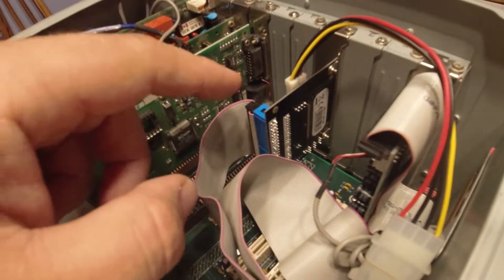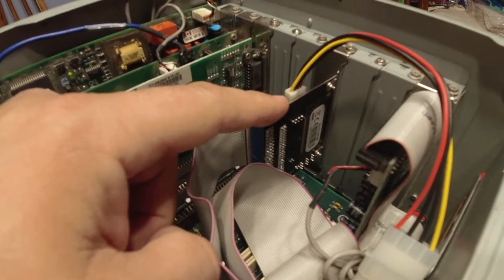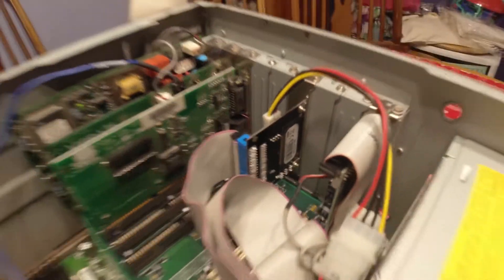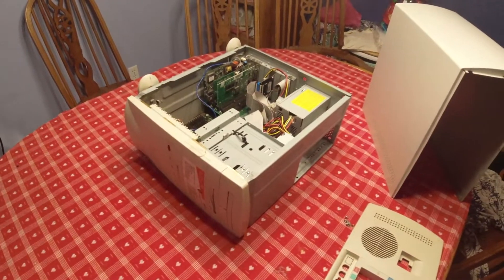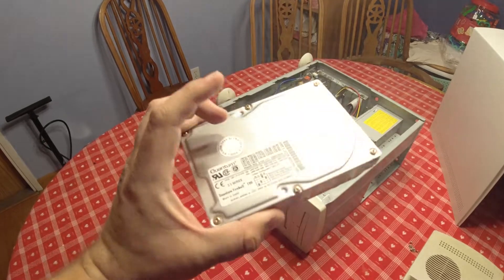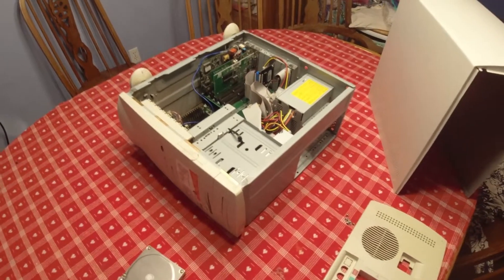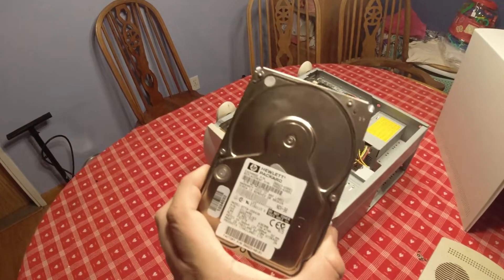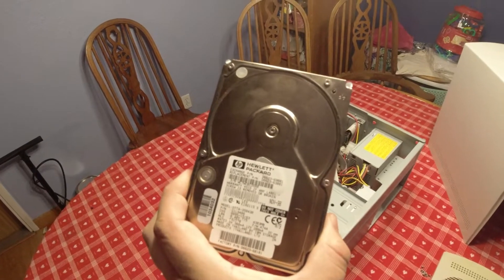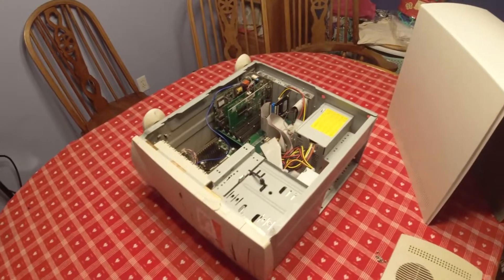Here is the replacement for our hard drive — a 4 gigabyte CF card with a reader attached, emulating a hard disk. My original hard disk was a Quantum Fireball one-and-a-half gigabyte drive, but that's almost dead. And apparently this machine also came with what I'm guessing is a factory replacement unit — a 4 gigabyte drive from November 1998 — but that one's also almost dead.